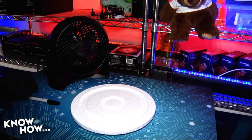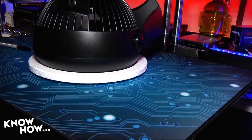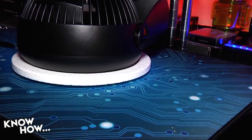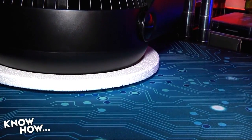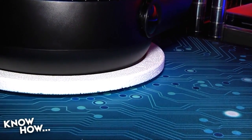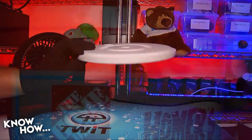We start our simple air cooler build by marking the outline of our fan in the lid of the foam liner. We're going to make a cutout to allow airflow from the fan to enter the bucket. If possible, mark the inside diameter of the fan because we need the hole to be slightly smaller than the fan housing or we risk the fan falling into the bucket.